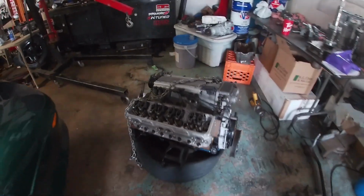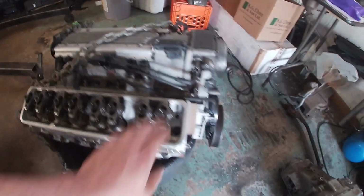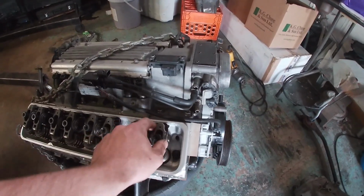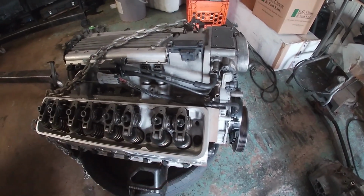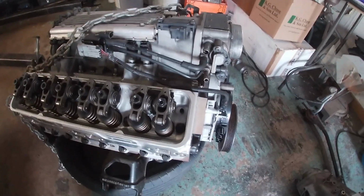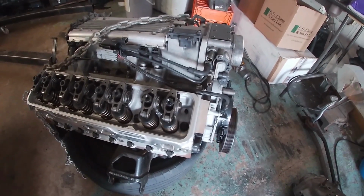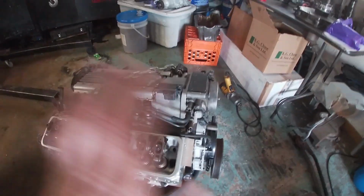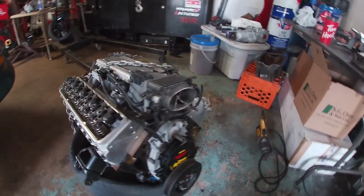So I'm going to set these all to zero. I talked to my old man and he's always set his with the big cams to zero lash, so you don't preload it after, you don't go a quarter turn. On a stock motor, you could technically go up to three quarters. Some guys even go to a full turn. You guys do your research. Your application will need what it needs.